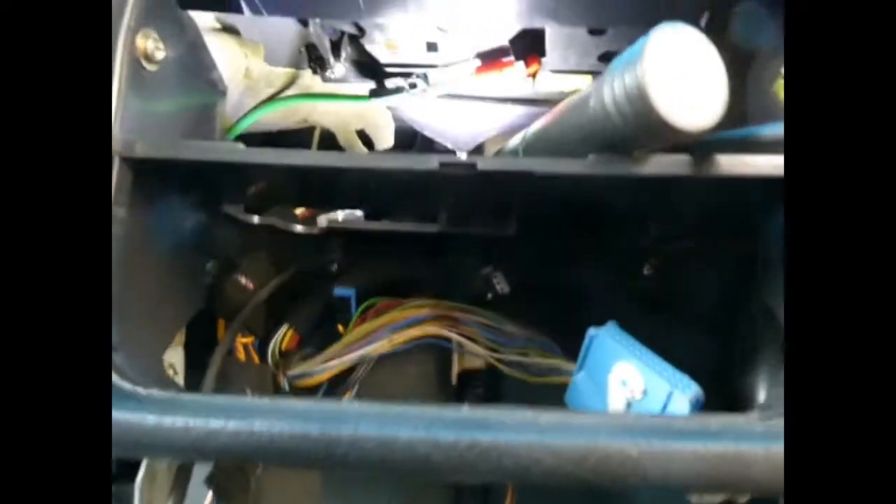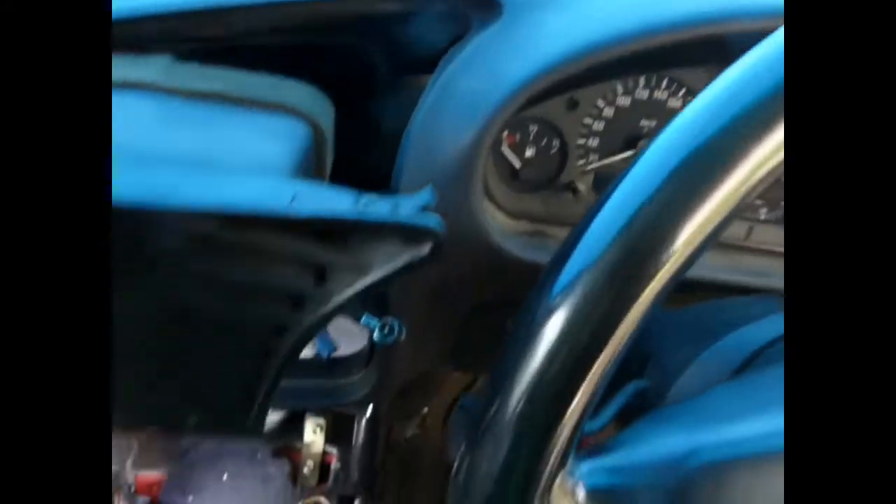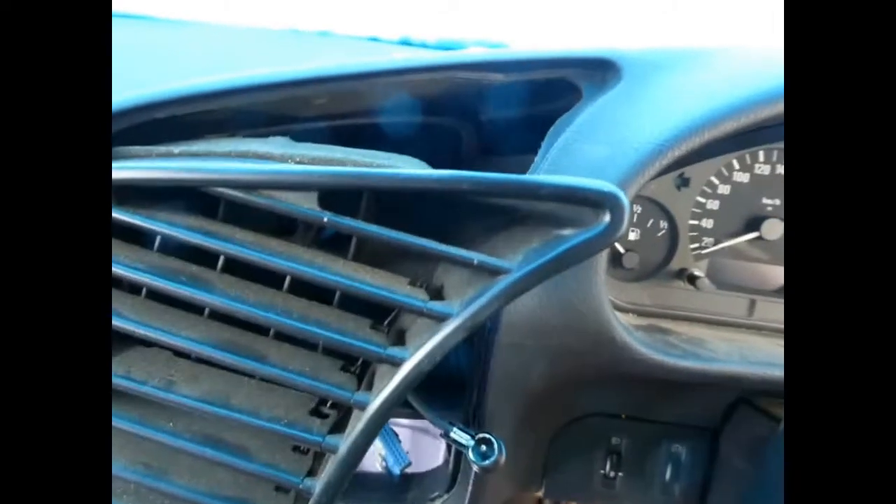Now to slacken off that screw, you can reach through here with about a four-inch screwdriver and undo that — loosen it off. This tab on this end fits in behind there, which is why this has to swing to the left to slide out. You can see the air duct into which it has to fit back there.